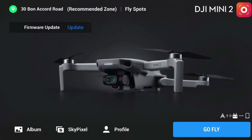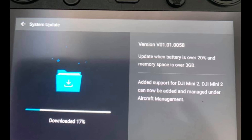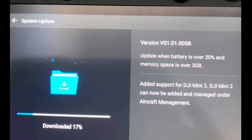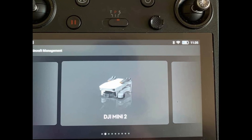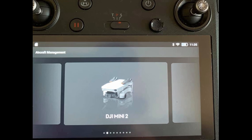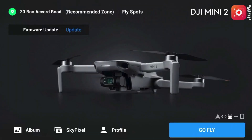You're going to have to do a couple of things. First, you'll need to update your firmware on the DJI Mini 2 and update your firmware on your Smart Controller. As you can see on screen, once you've updated both the drone firmware and the controller firmware, the DJI Mini 2 now comes up as a selection on the Smart Controller — which is really great news. You should simply get the prompts as soon as you open up the DJI Fly app, and the same prompts when you open the Smart Controller.